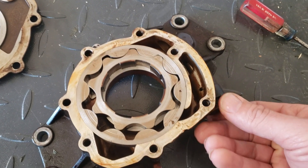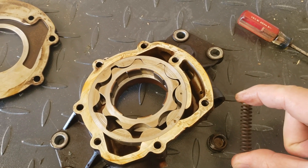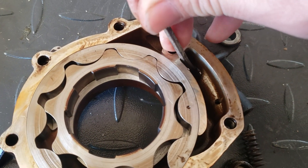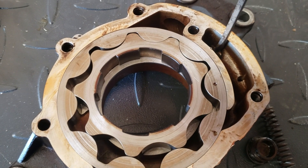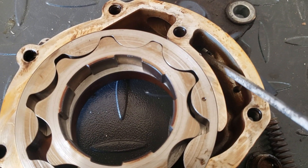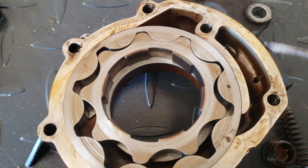But what I think happened with mine — and I'll pull this off and you can see there's a spring in here. When you buy a new oil pump, or at least the one I bought, it comes with different types of springs depending on what pressure you may want to run. There's a plunger in here that opens up if the pressure gets too high and then closes when the pressure lowers. And I think with this one, because it was set closed so long, that once it did open — when I first took it off, that's the position it was in. When I took all this apart I could take my screwdriver and just push it back in, but you could feel almost like there was a burr in there.